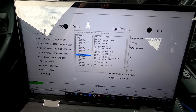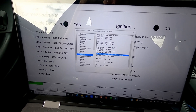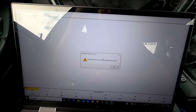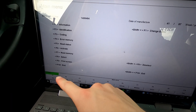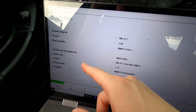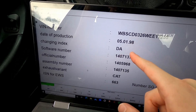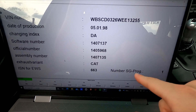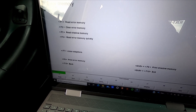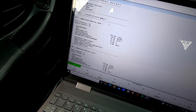For the DME, there is no S52 option in here. If you have an OBD2 E36 M3, you're going to want to pick MS 41.1. For M52 US with OBD2, that is the US option. It's going to give you this error — I don't know why it does that — but then you'll have all sorts of different options. For example, F1 shows various information, F3 shows VIN data, production software, network, and other stuff you'd normally only see on a dealer scanner. Going to F4 for error, let's go to read error memory with F1 — we see we have five errors.